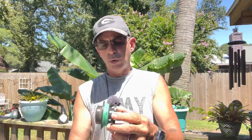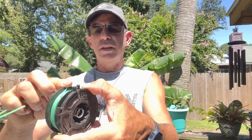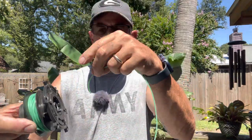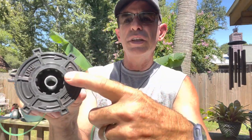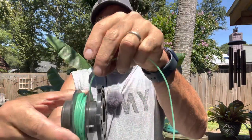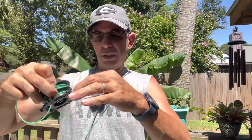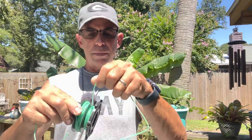String it up nice and firm — not too tight, not too loose — so it doesn't bird's nest on you. Stick it in the notch and hold it with your finger; don't let it go. Now take your second three arm length, stick it in the hook right there, pull it back, and follow the arrow. This is how you do a double line cartridge — if it were single line you'd be done. Have patience if it bird's nests; just undo it and keep wrapping.